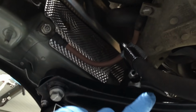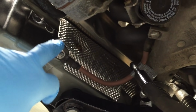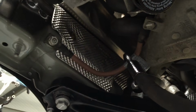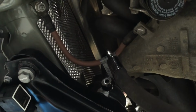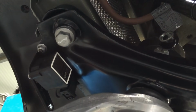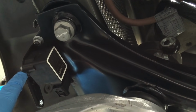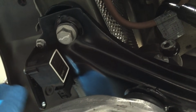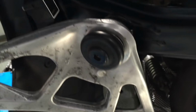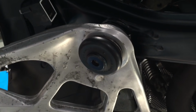So we've got new fixings on the subframe, the powder coated front subframe, new heat shields and fixings where possible, and the earth strap's been cleaned up just in the middle of power steering installation. And we've gone for a new Xenon drop link potentiometer on the front because the corrosion sets in normally on those bolts and expands and breaks the plastic, so we've got new hardware for that. The arms are in good condition, so they've been cleaned up and installed.